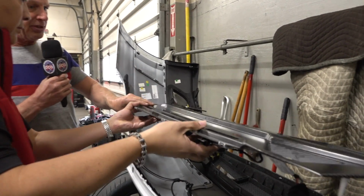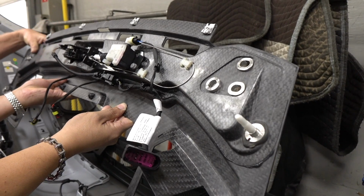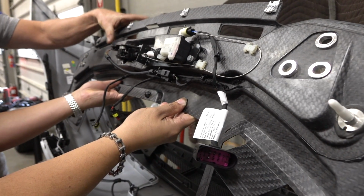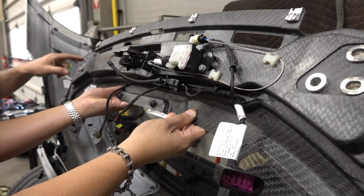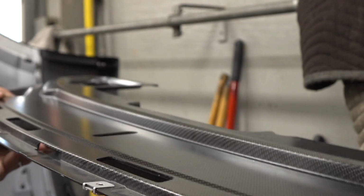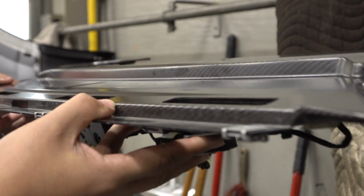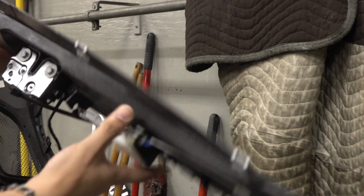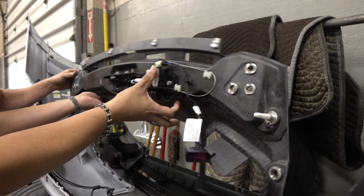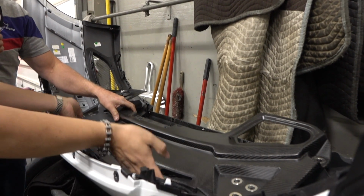This is a carbon component. It's definitely autoclaved and it's been bagged. Really high quality part, and it's in 2 pieces, so it's really acting as a structural member behind the car. It's definitely carrying a load. This is not just for a visual look. It's slightly heavy, right? I mean, it's light because it's carbon. But it's an I-beam, and it's an amazing piece of carbon. Very cool. And that is particular to the GT2.